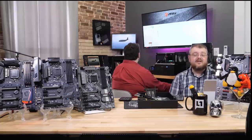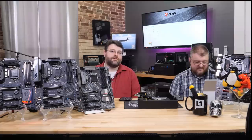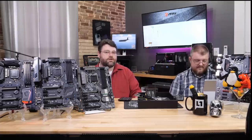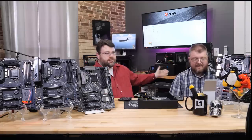How's the Linux path going? We already talked about that. These are sample motherboards, so I don't think we can fully test that until we get an actual production one. The onboard peripherals are grouped in individual groups, but on most of the motherboards that support SLI, you can run x16 or x8/x8. If you run x8/x8, the peripherals are in the same IOMMU group, so it's not great. If you're going to run a single GPU and the iGPU, those are in different IOMMU groups, so you can do that at least on the SLI Gaming Pro Carbon AC Z370 version.